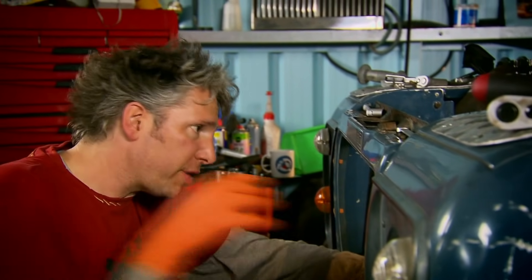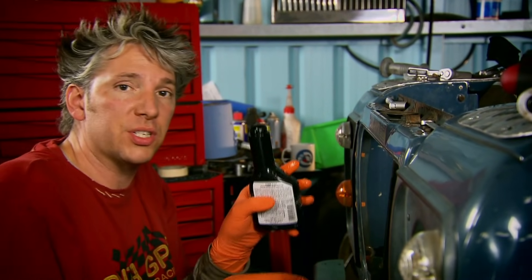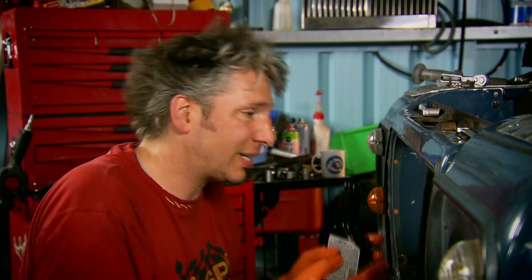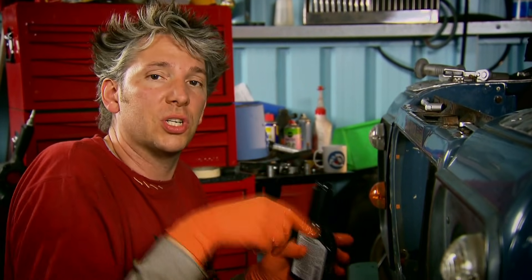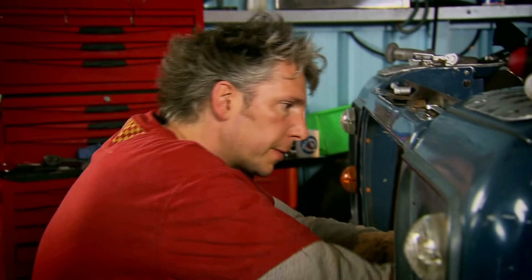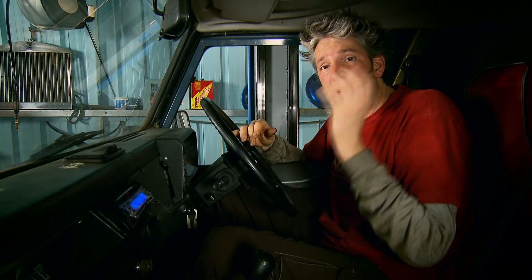Here's a great tip when reassembling engine parts like this: as I'm putting the camshaft into the engine, I'm smearing all of those surfaces with an engine break-in additive — basically a really super gloopy oil. That way it coats all of those metal bearing surfaces, and when you spin the engine up for the first time it's not going to grind fresh metal together; it's going to slip around nicely and bed in just the way it should. Once everything is done, I'll turn the key, and if I've done everything right it's going to fire into life. I then need to keep it running for about half an hour, varying the revs between around 1,500 and 2,500 rpm to help bed the cam in.